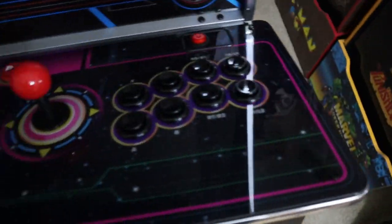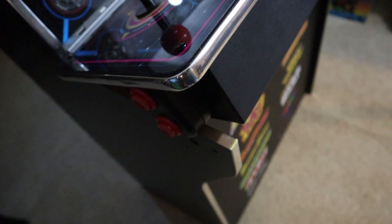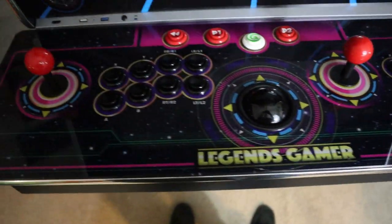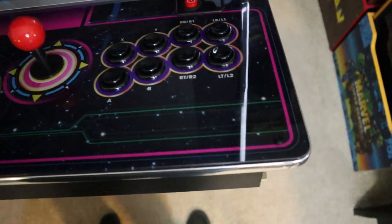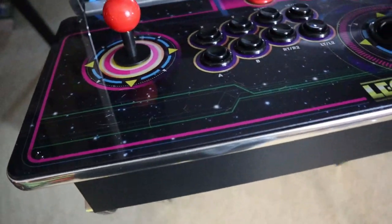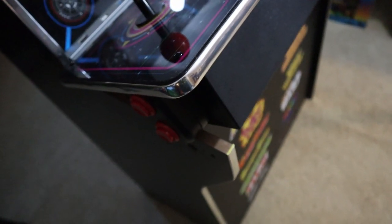Right here I have my Legends Gamer Pro. The goal is you're supposed to have swappable control decks, but just a heads up — you do have to remove the pinball buttons from the Gamer Pro in order to get it in there and then reinstall the buttons. I love that they are doing swappable control decks — you can get your Gamer Pro in there with the eight buttons for fighting games. But you do have to remove the side pinball buttons from the 1.1, then unscrew the side pinball buttons from the Gamer, and then mount and plug in your Gamer, and then screw your buttons back in. I honestly wish they had cut divots into the side panels where the pinball buttons wouldn't need to be removed and you could just drop them in. That would have been better.